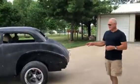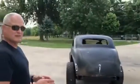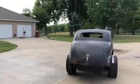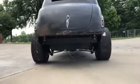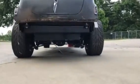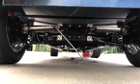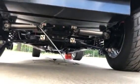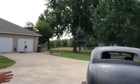On the rear end of the chassis, we got rid of the transverse leaf, switched it to coilovers. I got some aftermarket trailing arms, some giant aftermarket trailing arms. We went with 1 inch bigger half shafts. I went with a differential with 2.73 gears that was built for nostalgic Corvette drag racing, so it's a really heavy differential with a Kevlar clutch pack Auburn center section.